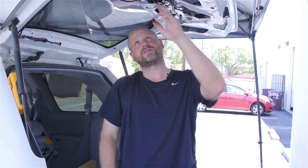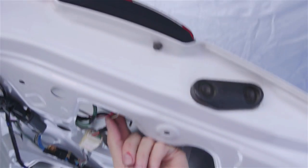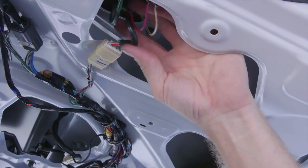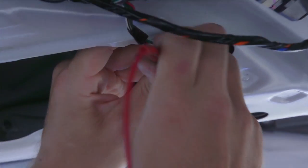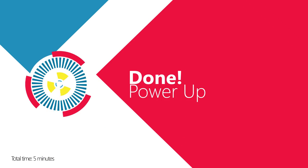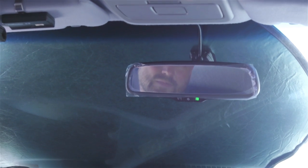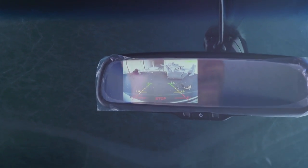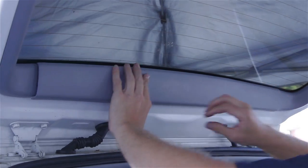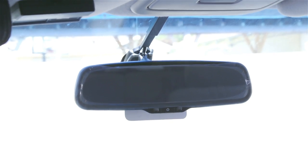As we showed you in the last video, how to test for reverse signal — there's one dead giveaway in this particular vehicle: on both bulbs there's a white and black wire, more than likely the common wire or ground, and the red being positive 12 volts. We'll go ahead and test it so you can see it on a voltmeter. Now that we've made all our connections, all we have to do is turn on the vehicle, put it in reverse, and we should be good to go. There we are! Now we'll just go ahead and put everything back together. Hopefully this video helps on your next backup camera installation. Make sure to check out QualityMobileVideo.com for all the latest backup cameras and monitors. Thanks for watching, leave your comments below, see you again next time.